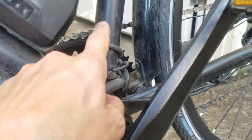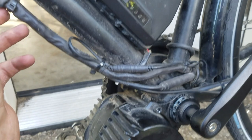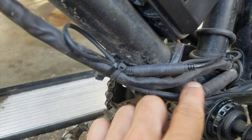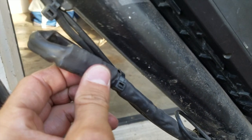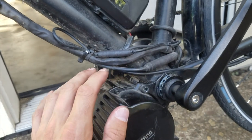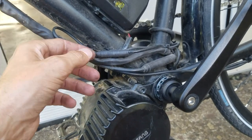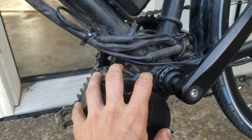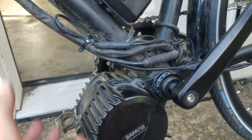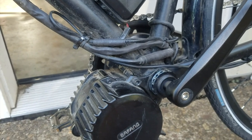Say you ever want to move this system to a different bike — one of the things I did when I first got this is I heat-shrunk all the connections. You can see I heat-shrunk all the connections here, and the battery connection too, so no water, dirt, grime, or grease gets in. Those connections have been flawless. The problem is, if I want to take this kit off and put it on another bike, I now have to cut all the heat shrink off. It would have been nicer to just wrap the cables up neatly so you can pull the whole kit off with the wiring intact.